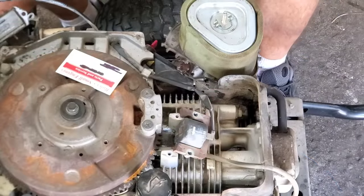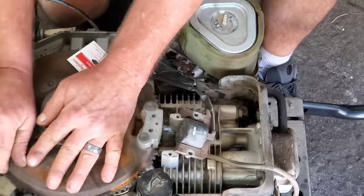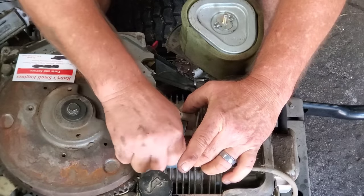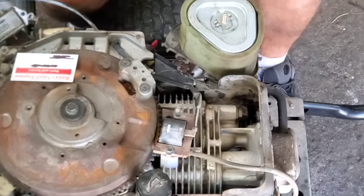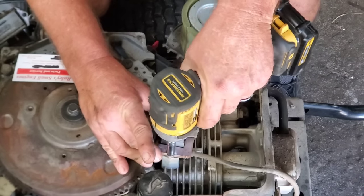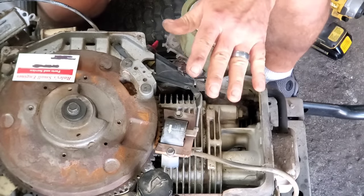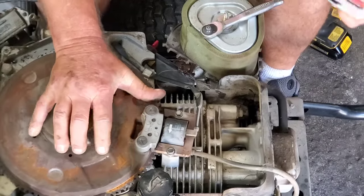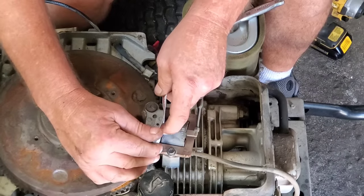So now, you have to have a special tool. It's an adjustment tool right there to get the proper specs. It only works with a Rayleigh Small Engine business card. No, I'm just kidding. Just get any business card, it'll be fine. We're gonna buzz these in right here. Now, what I'm gonna do, you see this moves in and out a little bit. I'm gonna push it back and just run them down just a little bit, okay? One ugga dugga is all you need. And we'll take our business card, and get our magnet right here lined up right in the center, exactly there. Put your business card in.